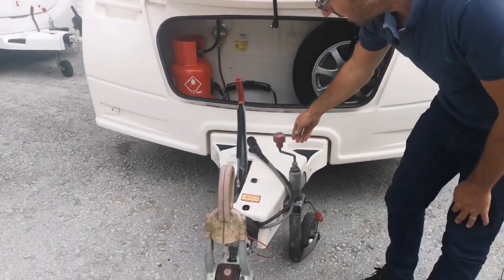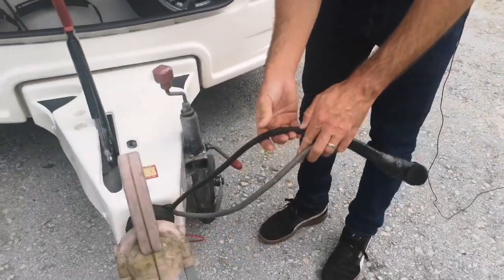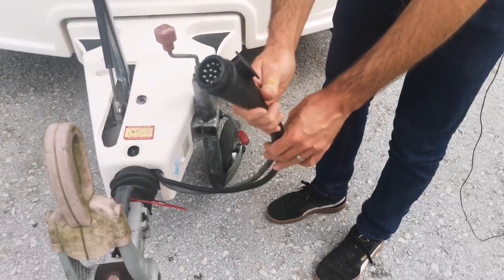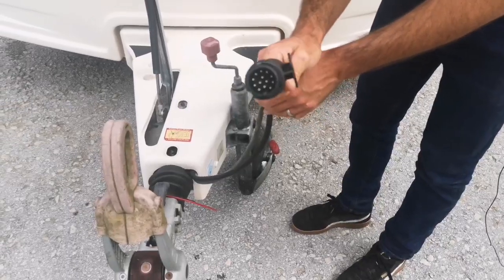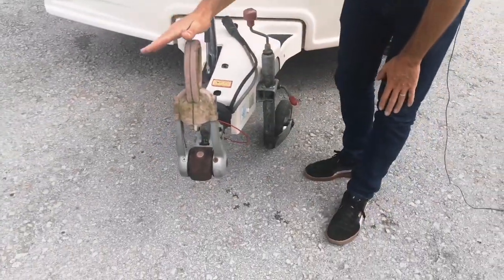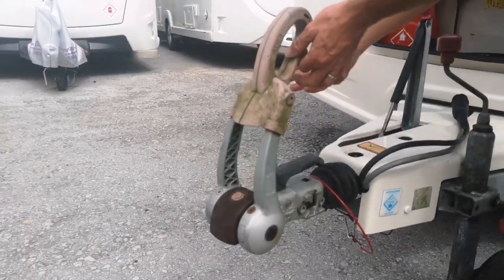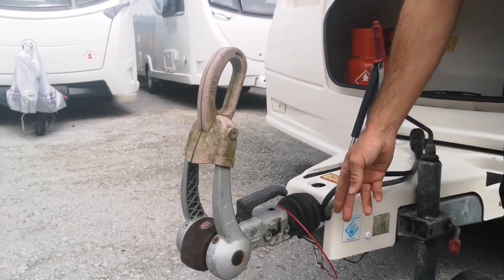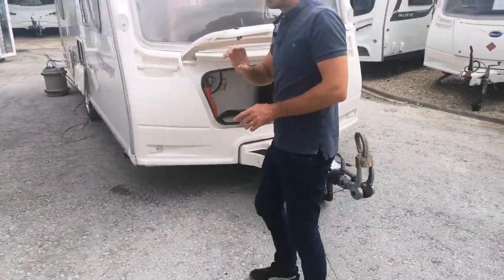While we're at the front of the caravan, this is set up for a 13-pin adapter on the car. A lot of the other Bailey caravans of this age will be set up with a black 7-pin and a grey 7-pin, but this one has had the newer conversion done so it is set up for 13-pin. Just make sure your towing vehicle is set up with 13-pin, or you can buy a converter that will go 13-pin to two 7-pins. We're also fitted with the AKS 2004 stabilised hitch head. There'll be a link to our hitching up guide in the description, covering the breakaway cable, the black handle, and how to hitch up onto the car.